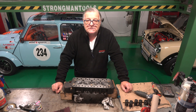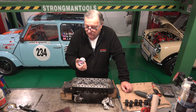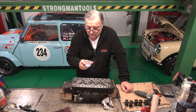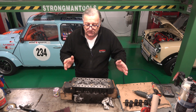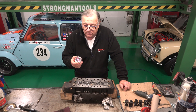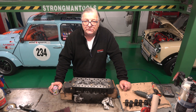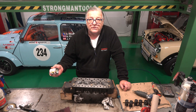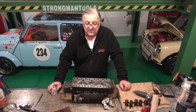With the grade of paste you use — like I've already said with this paste, I don't think it's that good. I don't know what the grit is in it. I can't see it goes down to the proper specifications. When I was talking about how quickly the grit goes, it might be because it's quite a low grade — not 240, maybe it's 300, 400, or 600 for the coarse, and maybe 800 for the fine. That may be the reason it's not lasting as long as I thought. Maybe the older pastes had much lower grit — maybe 150s, 200s, and 400s.